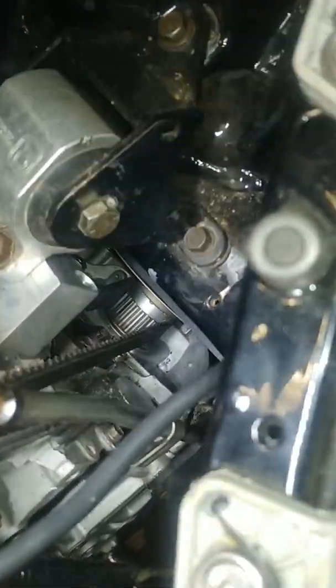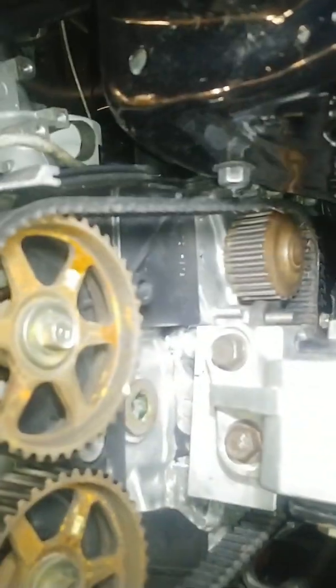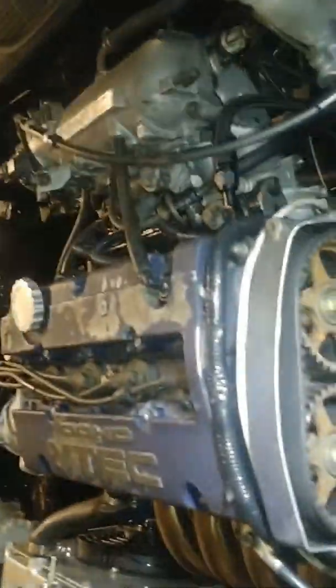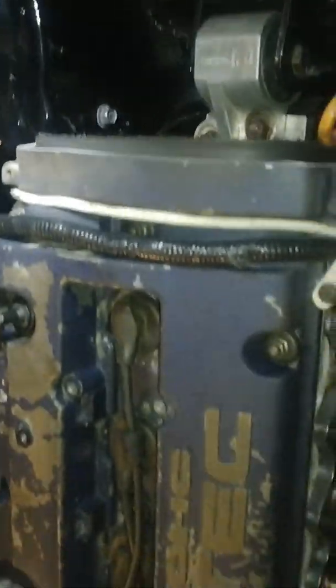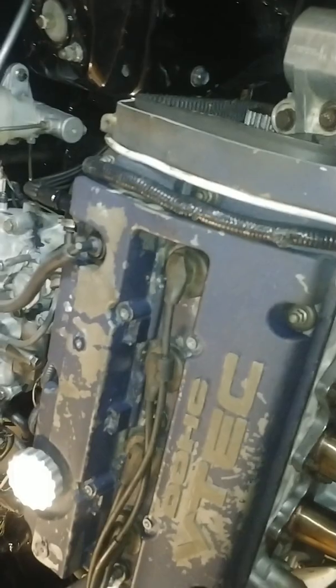It's a PLM kit — it's a QSD knockoff but it's supposed to be the same kit. I can tell some differences but it does the same job. It's sitting in the car so the axle alignment still looks good. We're going to put this top dead center, pull the alternator belt off, and start pulling the valve cover off. I'll show you guys inside the head and then how I do it. I usually lock the cams. If you've got the Pro 2s you can't lock them — you've literally got to do it by eye — but I'll show you here on these Type S cams or basic H22 cams.